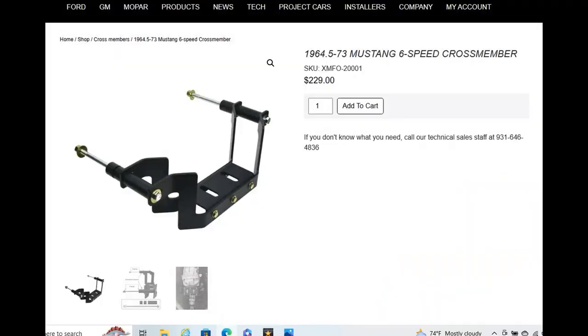A better solution would be to use this American Powertrain crossmember. It mounts at the stock mounting point on the frame and then swoops back to the mounting pad on the back of the transmission and appears to avoid any interference with the parking brake cables. I've linked an American Powertrain video in the description below that shows a Tremec Magnum installed in a 69 Mustang where you can see this crossmember. An added bonus of this crossmember is that it's $200 cheaper than the mount that came with my kit.